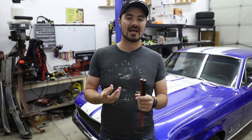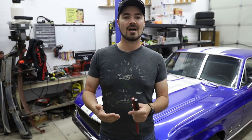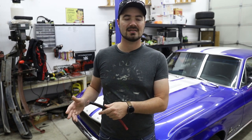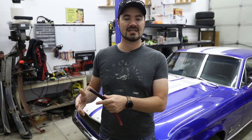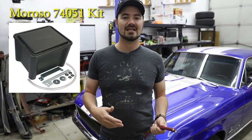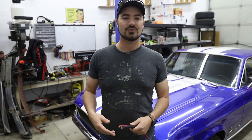In my case, I'm going to be using a plastic battery box that has the capacity to be vented properly, and I will be mounting it off to the side of the trunk here to keep it a little bit away from where the mounting points are for the fuel tank. A battery box serves both functions of protecting the battery and containing the poisonous gases the battery might give off during an overcharge, or containing an explosion should the battery end up becoming overcharged or having the polarities crossed during jumpstarting. This battery box is a slightly more expensive box, but you can use almost anything that's a fairly good heavy plastic or even some metal battery boxes, as long as you understand that you now are introducing the potential for a short directly up near the terminals.